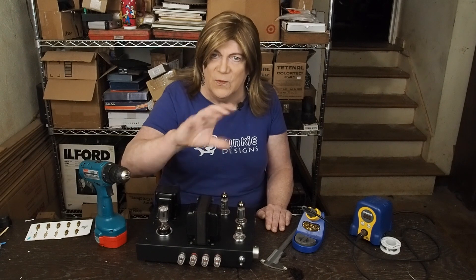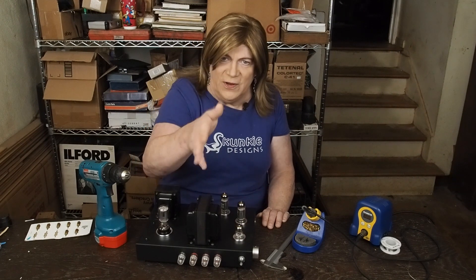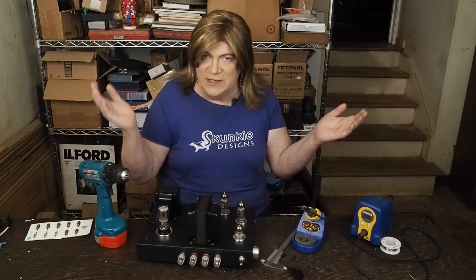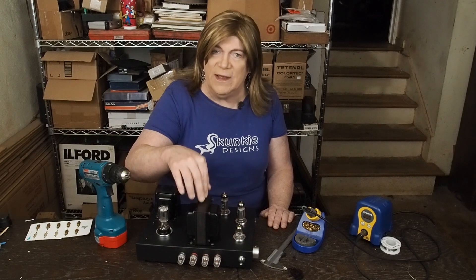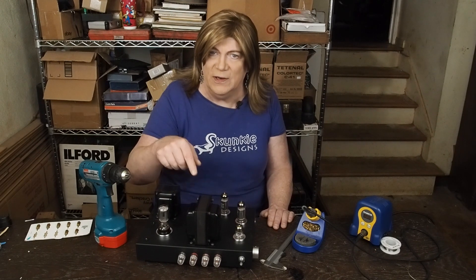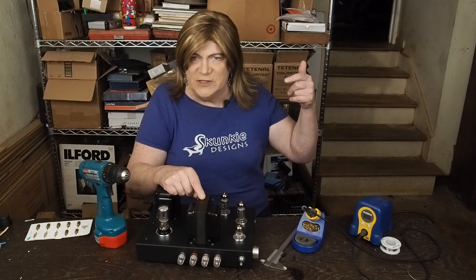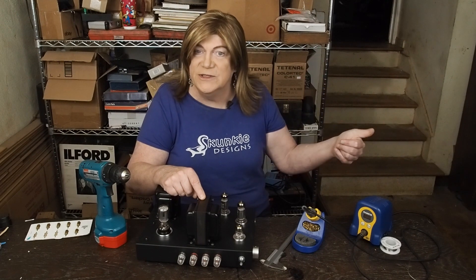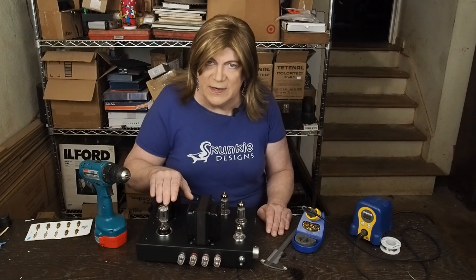We plugged that APC unit into his outlet when it was going over 135 volts, and it was regulating the voltage down to a safe level because it's got a switching device and different transformer windings where it can pull the voltage down — obviously there's a limit to what it can do. The other good thing it does is if the power goes off and on in succession, like during a lightning storm right before a transformer blows up, it won't turn back on that quick, and it'll keep from spiking current to your tube amp and killing your rectifier tube. You can also set it to 110 volts if you have Chi-Fi gear that runs on 110, or like my Variac runs on 110 — it will make it read correctly.